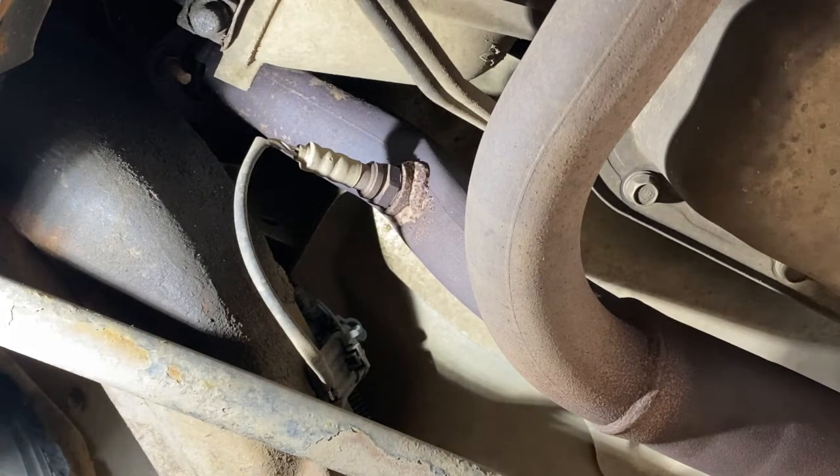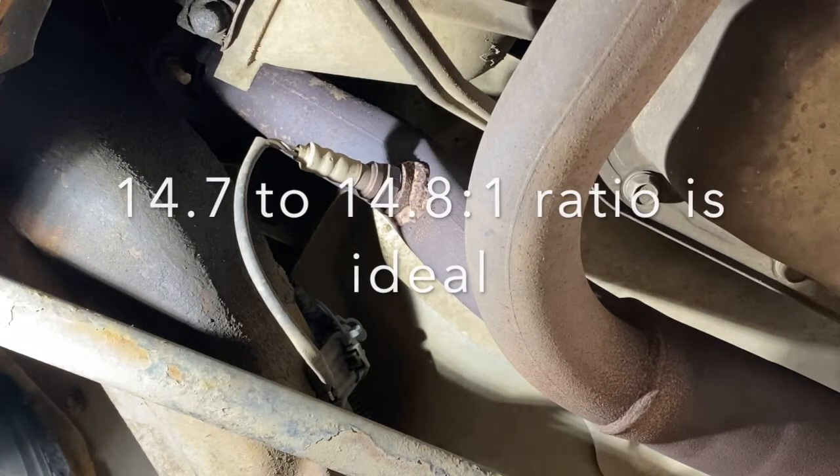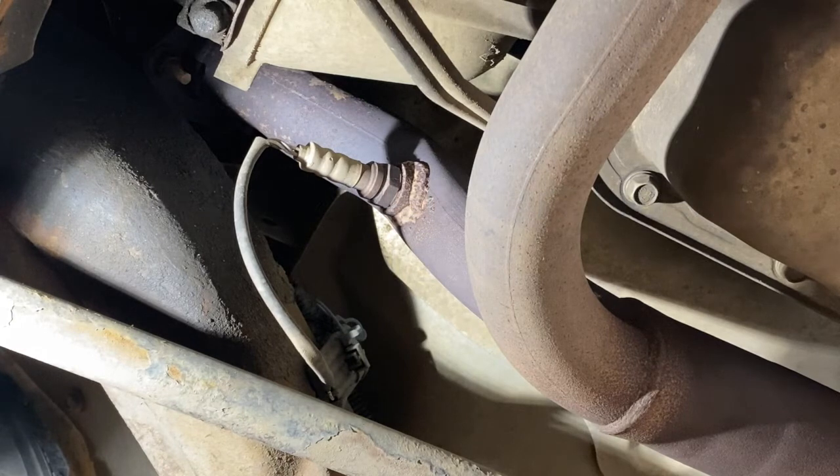Stoichiometric ratio is an ideal burning of the fuel so we don't end up with an excessive amount of byproducts such as carbon monoxide, hydrocarbons, nitrous oxides, et cetera. Our goal is to get as close to running water vapor out the back, and CO2 is the ideal product that we're looking for out the tailpipe. And even in this day, we're trying to bring down CO2 — it's the best product we can get out of combustion given that we've got hydrocarbons.